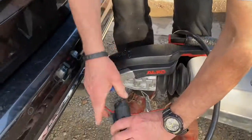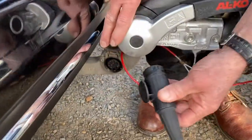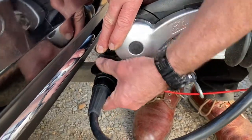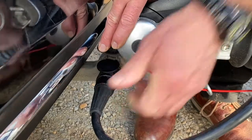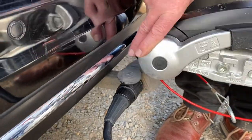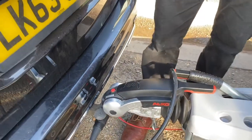That allows me to bring it back into the right location. Bring it over the top of the coupling head — the lug goes in the 6 o'clock position, down like so. That's in the 9 o'clock location. Then you rotate the outer connection so that when it comes across, that's in 12 o'clock and it goes neatly over the top to hold it in place. That's the 13-pin coupling.